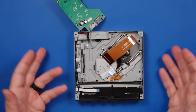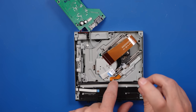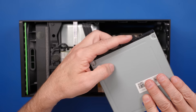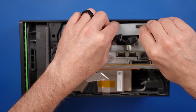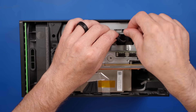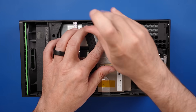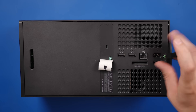Now back into the drive. I'm not going to show all the rest of this - you've already seen it at least once today. Before I do that, I am going to clean off this rubber roller right here. That will help the disc slide in and out much easier. Disc drive is all back together. Get it installed - there are these little pegs that stick out that have to fit into little grooves in the case. It'd help if I put it in not upside down. There we go. Now I'll install the correct screw that goes over here. That feels better. Then the foot goes on, back cover goes on, and the last two screws go in. Then we can test it.